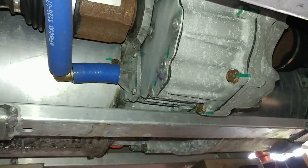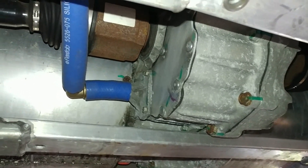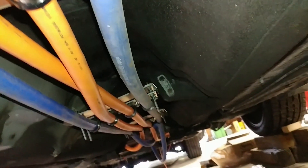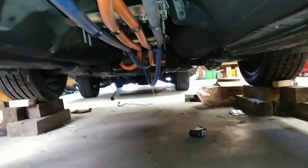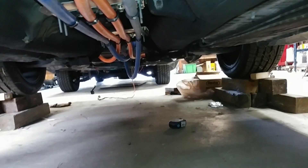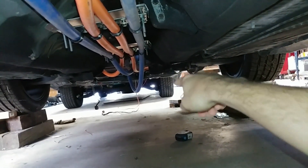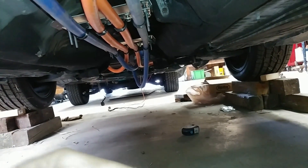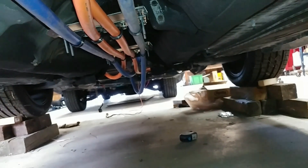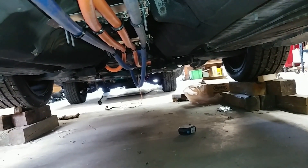Here's where the water comes out of the motor — it just goes through this right-angle fitting, then the tubing goes underneath the CV joint and comes back up, and goes back up to the front where it connects up to the radiator. I haven't cut it to length yet so it's still hanging down. I need to add some more brackets up front to hold it up under the car, as well as brackets to run the orange cables since they kind of rub on some stuff right now.